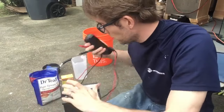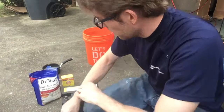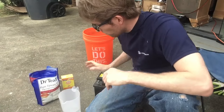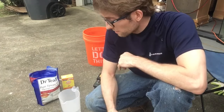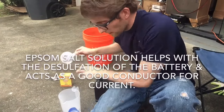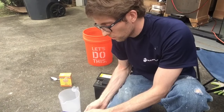So I'm at 12.43, that looks pretty good. First thing I'm going to do is get some distilled water — you want about three cups. You don't want it to be quite simmering; water simmers at 190 degrees. I heated this water on the stove just before it got simmering, so maybe about 150–170 degrees Fahrenheit. We're going to use one cup of Epsom salt — this is exactly what your car battery needs. The Epsom salt is going to dissolve in the distilled water; you want to make sure it's distilled water.